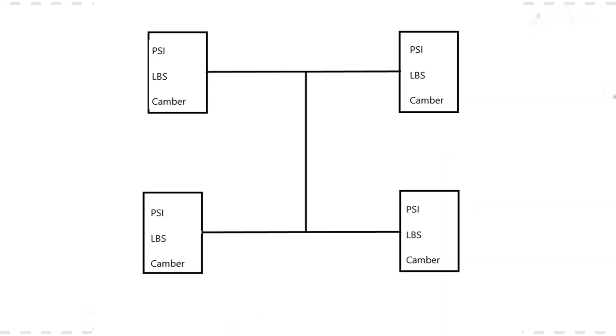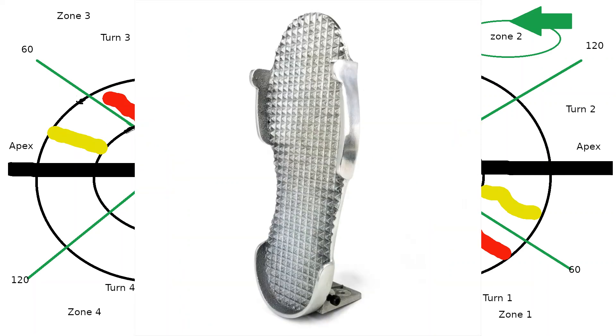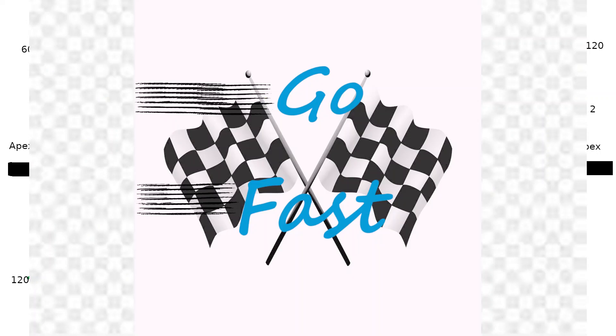Also, too hard of a suspension can put too much tread down, along with your associated tire pressure and so forth. The driver must hit the marks of the entering and exiting points in the turns. How long the driver's on the gas? How many RPMs is the car actually turning? Because the tire revolution itself is naturally going to be a lower amount than the RPM. However, the wheel RPM is very important because that dictates how much speed you can actually carry into the turn.